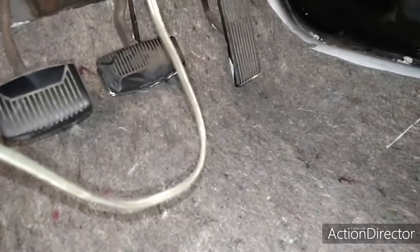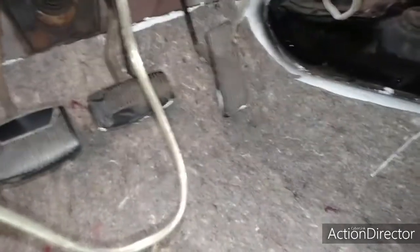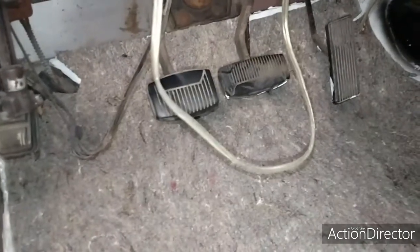So now I pretty much got it all cut to fit in place, went around the seat belt. One note: this isn't really for padding like for cushion - I'm mostly doing this for soundproofing. Because this is a pretty loud truck. Before, you couldn't even really have a conversation in here because it's running straight headers, and it's pretty loud. It has mufflers but they're like rotted and gone. Hopefully I'll be replacing them, but this is mostly for sound deadening - you really don't have to do this, I'm just doing it for that reason.